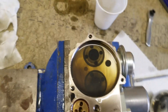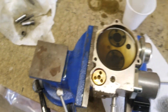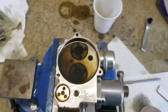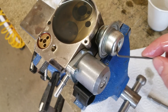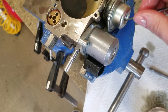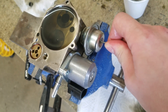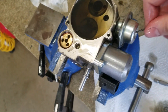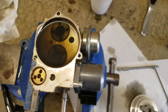The other thing is when you put it together, it's difficult to get enough oil in. You're going to have to, when you put it all back together with the oil and then put this on and screw it down, the oil is going to want to squirt out, but you need to get enough oil in there to compress the spring. So when you put it back together and screw that plate down, the best thing to do is to retract the spring — I'm just using an Allen key in there to pull back on the spring — so there's no pressure on that diaphragm and it can just move freely to fill up with oil in the chamber.